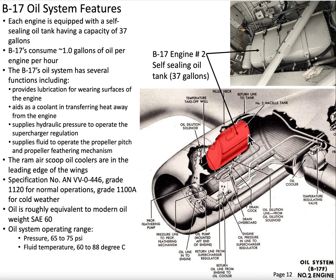The oil is also going to be used as a coolant to transfer heat away from the engine. These are air-cooled engines, but the oil helps transfer some of that heat. Looking at the leading edge of the wing of the B-17, each engine has three ram air scoops. One of the ram air scoops is the oil cooler, and you can see it here in the schematic. The airplane travels on a combat mission at about 240 miles an hour at 30,000 feet, where the outside air temperature is about minus 50 to 60 degrees Fahrenheit, making it an excellent cooling medium for the oil radiator.